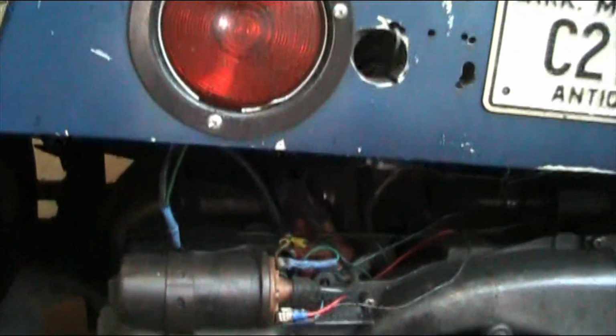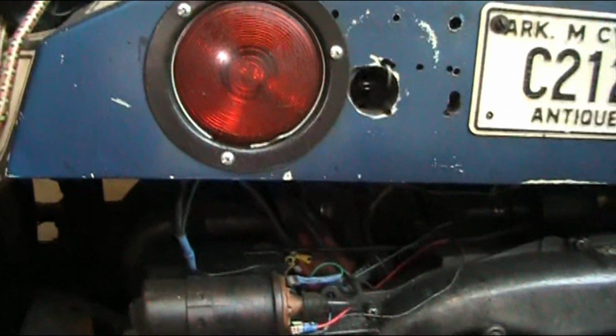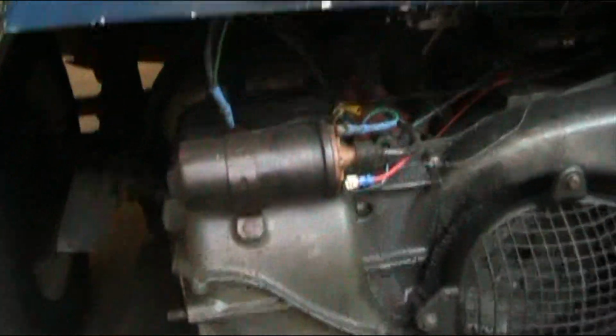But he was talking to me because his carburetor here, he said, was flooding, and he thinks it's in the float. I'm hoping I can see what's wrong, because it's supposedly a pretty close to brand new carburetor, so they may have just assembled something wrong. But when he bought the carburetor, they didn't give him any clips, so he just zip tied this thing on. He was going to order the clips, but never got around to it, I think, because it started flooding.